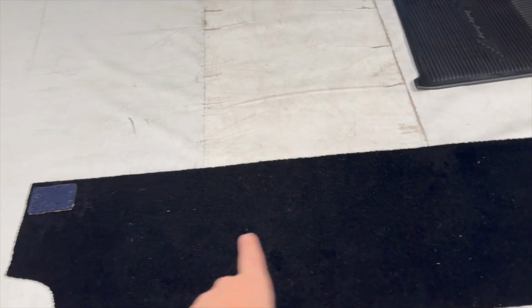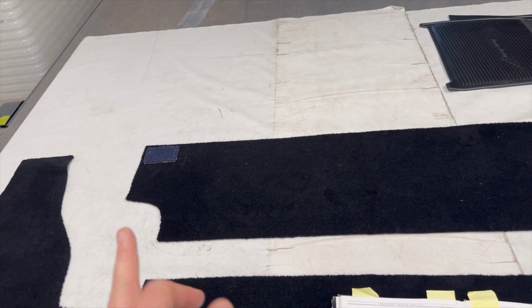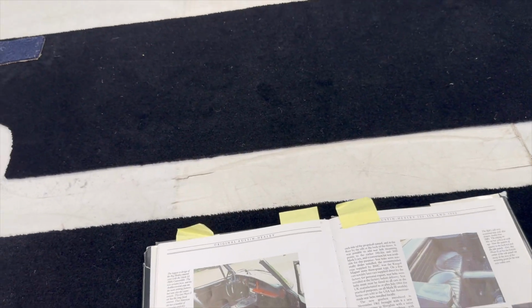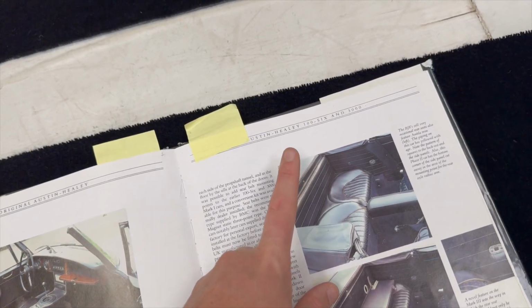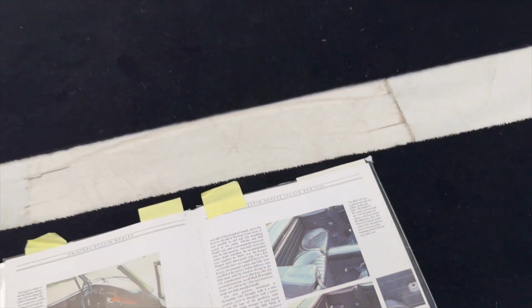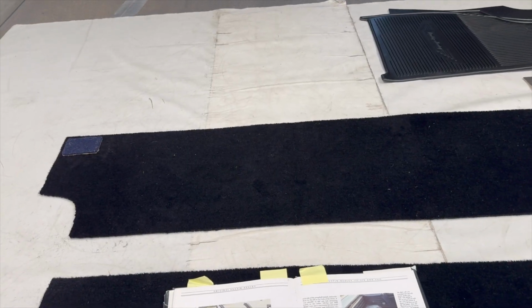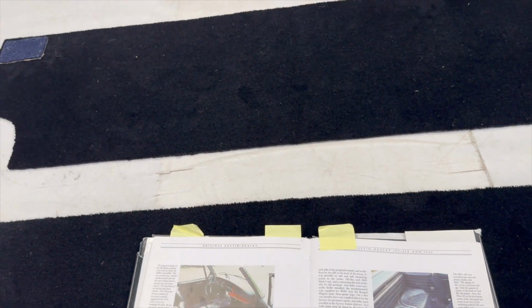Those ones there. And then finally, you get this effectively rear bulkhead carpet here. Now it's worth noting on this one, we supply the carpet here for the BJ7s and the BJ8s with carpet section there, but the earlier cars, they didn't have carpet there, and it's all related to the change in the soft top convertible hood and the hood frame cover. The BJ7s and the BJ8s had quite a good design where they had this gutter system that caught a load of the water that came down at the back of the car. Whereas the earlier cars didn't.